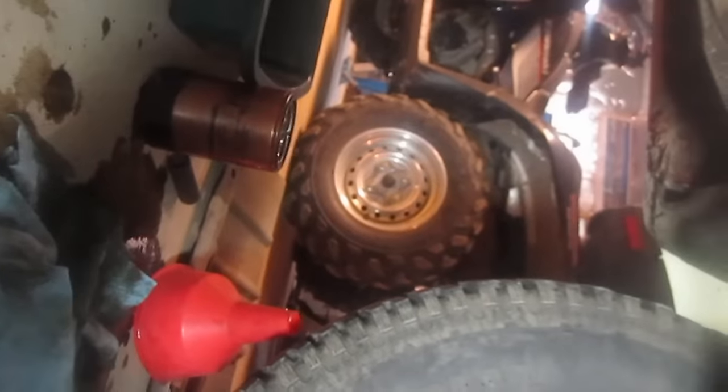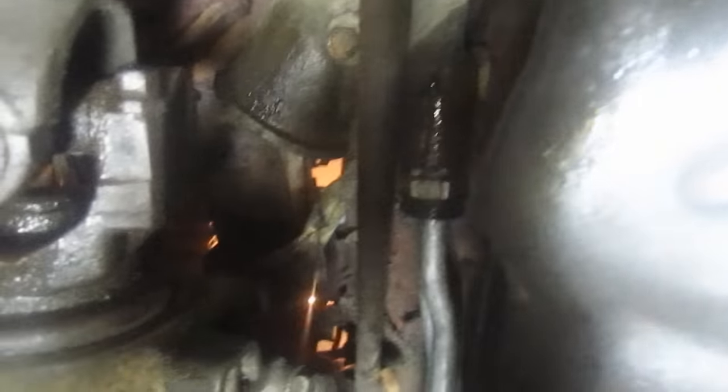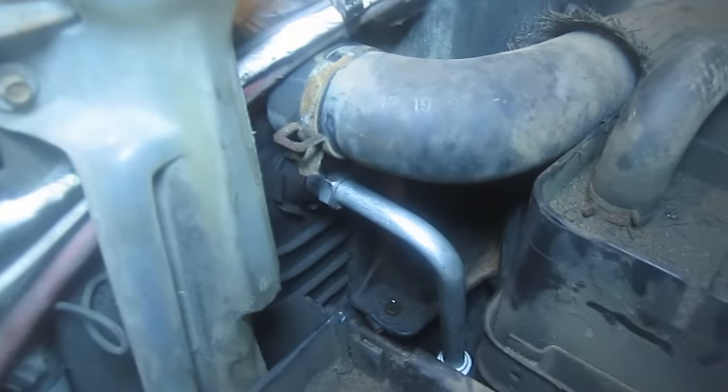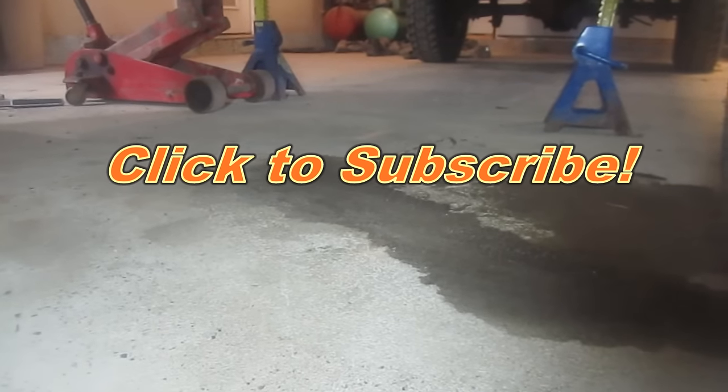I need to top off my oil since I had it filled up and pulled my filter and lost some. If you're doing this job, take your time. You might want to consider replacing these quick disconnect fittings up front. If your filter housing gasket is leaking, you could easily change that by pulling these two bolts — so you might consider doing that at the same time. It's not a difficult job — it's just a little time consuming and a little bit messy, but you can do it. Leave questions in the comments below, and if you found this video helpful, give me a thumbs up. If you'd like to see more, hit that subscribe button. Thanks for watching and have fun.